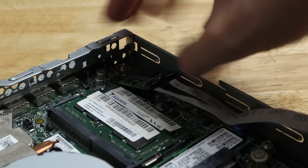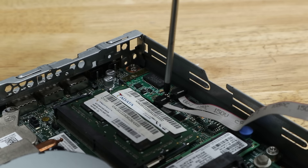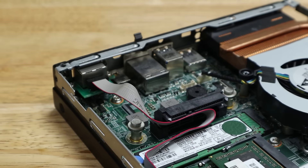When using an HBA you lose the potential for higher-speed networking since there's only one PCIe slot, but a possible solution is the fairly cheap Realtek gigabit and 2.5 gigabit cards that can be installed in the M.2 E-key slot and screwed into the back of the case where the extra DisplayPort was previously installed. I tested a Realtek RTL8111 model and it worked fine, although something to be careful of is preventing it from shorting out on the barrel jack underneath — I would just use some Kapton tape for that.